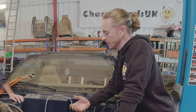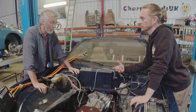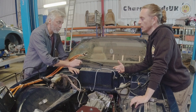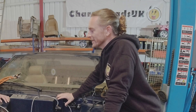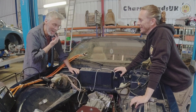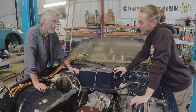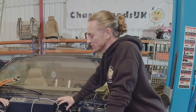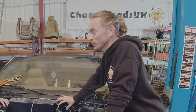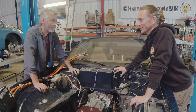So the motor still goes through a gearbox — it's not direct drive. This unit spins up to about 10,000 RPM, and at 10,000 RPM we should give you a theoretical top speed that the car would never actually reach due to aerodynamics, so it would just be pointless and the acceleration would be quite poor. Have you done the calculations to work out what the top speed would be? Yes, I have.